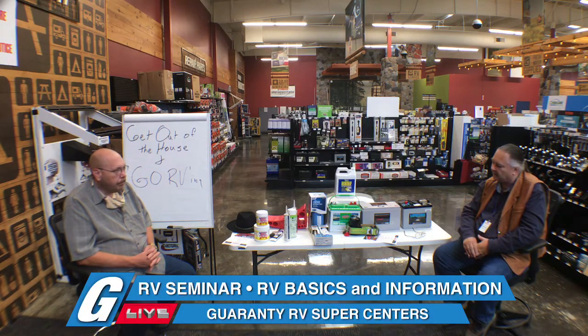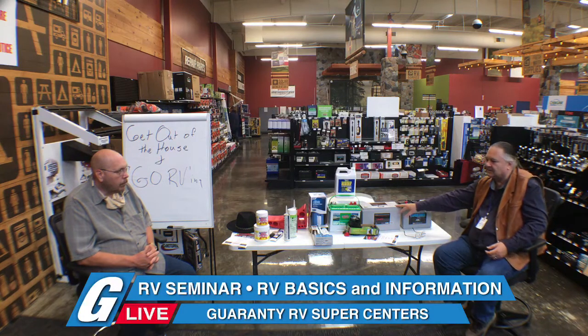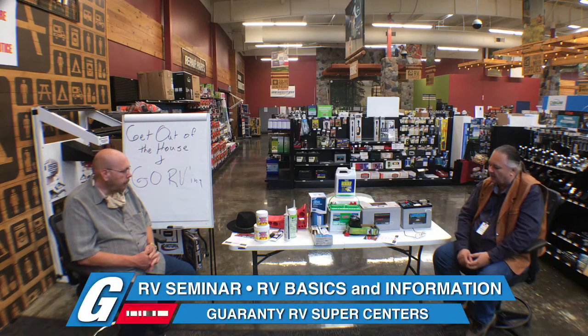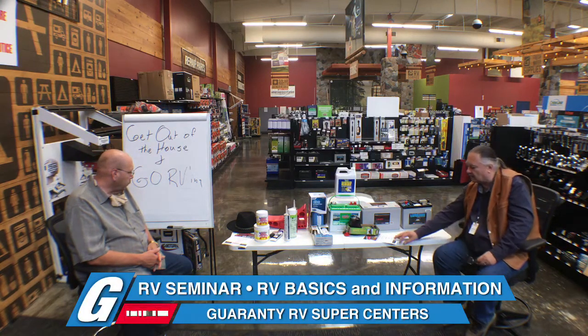If you've boiled out your battery three-quarters and you fill it with water thinking you're fine, only a quarter of it — if you're lucky — is going to work. You've got to maintain them. If you're the kind of person that only maintains the water level in your martini, you need to look at AGM or lithium, because those flooded cells are going to kill you. Batteries are the heart of your RV.